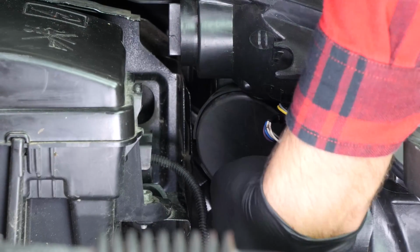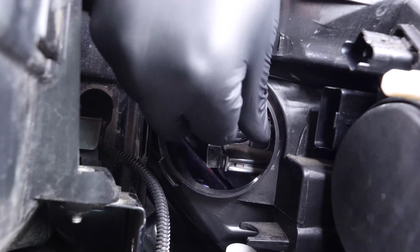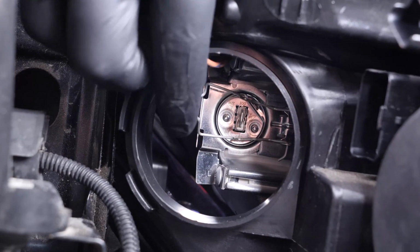To change the bulb of the full beams, remove the closing cap on the bodywork side. Remove the electricity connector for the light bulb by pulling on the back part, not on the wires. Lift, then move the holding clip on the bulb and remove the bulb.